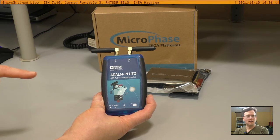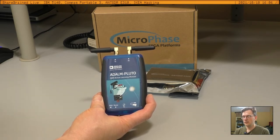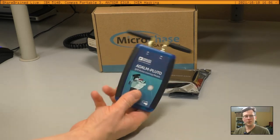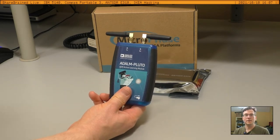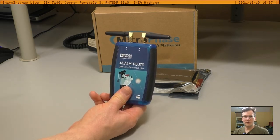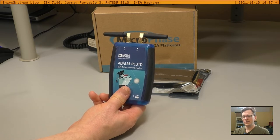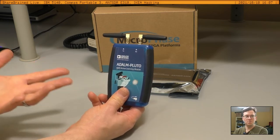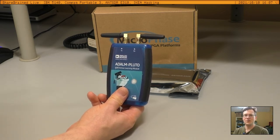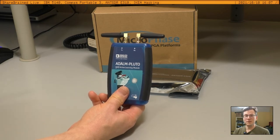And then they connected it to an FPGA. I think it's Xilinx Zynq. So it's got a little ARM processor in there, like a Cortex-A9, I think. And a USB port. And now you've got a completely self-contained software-defined radio that can run real software. Like, it's not a deeply embedded software-defined radio like the HackRF, where you've got 200K and a 200 megahertz processor. You've got a pretty big FPGA and an application class Cortex processor in there. So you can do some really serious stuff.